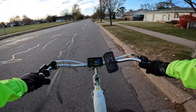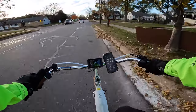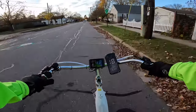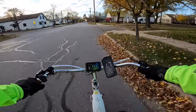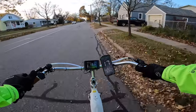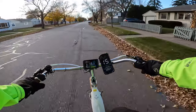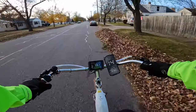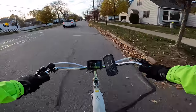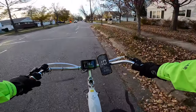Throttle only: 10, 13, 17, 20 — there's 20 miles per hour. So it's a class two electric bike with the throttle cutting out at 20 miles per hour. Going into pedal assist four with the throttle, it looks like that keeps us around 18 or 19. Pedal assist three gives you about 15 miles per hour with throttle only. Down to two, dropping to about 13-14. Down to one, and now we're going down to about 10 miles per hour.